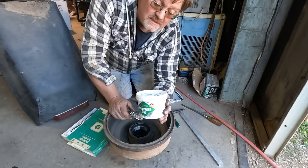This whole time I've been debating taking this back cover off - I could drain out the old fluid and see what condition everything's in. But then I'd know what condition everything's in, and if there's a problem I might feel obligated to fix it. There's a lot easier to ignore if you don't know about it. Since I'm going to be taking fairly long trips with this, I probably should know now rather than on the side of the road. Well, I don't see water - that's good. Doesn't look that bad. We're going to call this totally fine - a little bit of rust here and there, but rust will wear off as you use it. I don't see anything major, so we're putting this back together and putting some new oil in it.